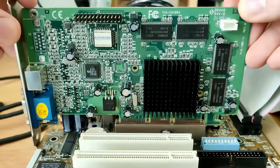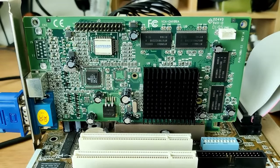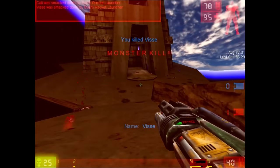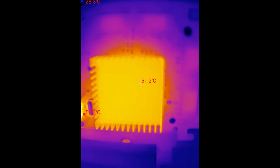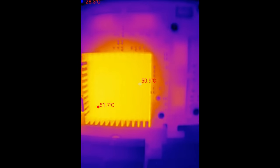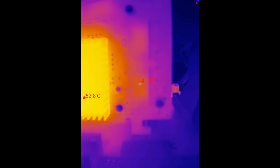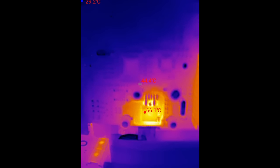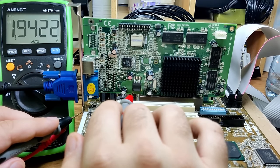We start with the passively cooled GeForce 2MX. The card features 32 MB of SD memory connected using a 128-bit data bus to the GPU. Throughout my tests I will use both cards at their stock frequencies, with the memory clocked at 166 MHz and the graphics core at 175 MHz. At idle, the passively cooled card reaches a temperature marginally above 50 degrees measured at the heatsink with my InfiRay P2 Pro thermal camera. The memory is about 10 degrees cooler at 41 degrees. We also see a voltage regulator close to the GPU, which should provide the required voltage to the graphics chip.